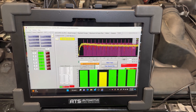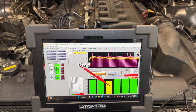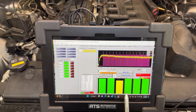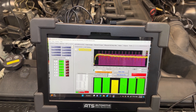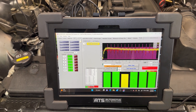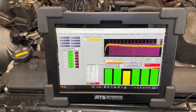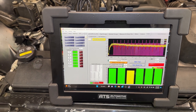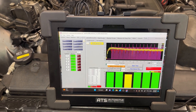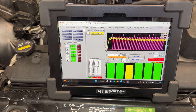We definitely have a mechanical issue on cylinder number three. Based on the waveform captured from the crankshaft position sensor, there is no doubt — we need to go in-cylinder with all the pressure transducers. This will likely be part one since I still need customer approval to proceed. I want to keep the videos as short as possible with preliminary tests first. Stay tuned for part two — thanks, don't forget to subscribe!